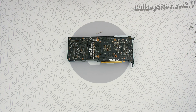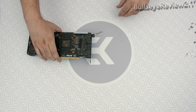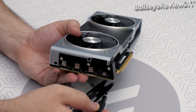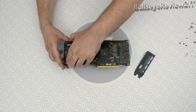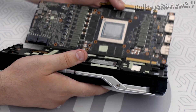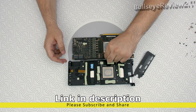There are different types of screws from one graphic card to another, so using an appropriate screwdriver is essential. You may or may not remove the I/O plate, but if you do so, the block installation will go smoother. Now remove the housing and don't forget to unplug the fan cables.